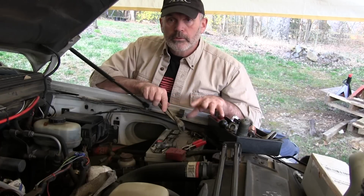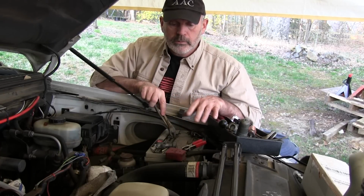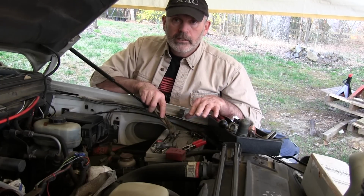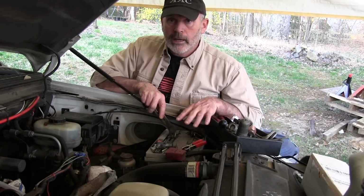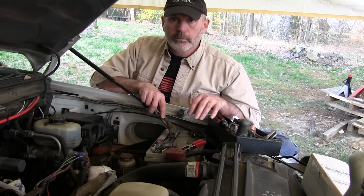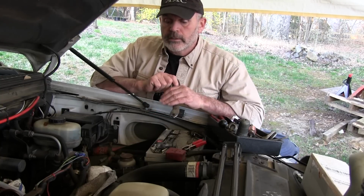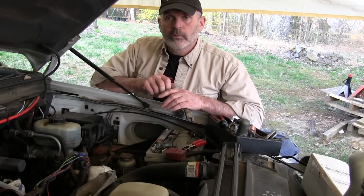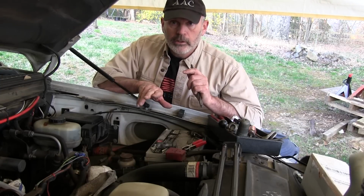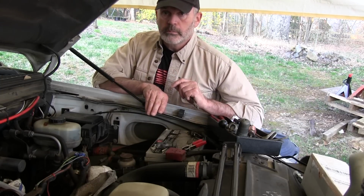So the terminal's never going to wear out because of the battery on this one. But if you have a regular lead acid battery, even if it's a maintenance-free battery that has the caps mostly sealed up, gas can still come out of there and cause your terminals to corrode. And one circumstance where it will gas a lot is if your voltage regulator goes bad and you overcharge the batteries. Now, not you, but the alternator will overcharge the batteries.